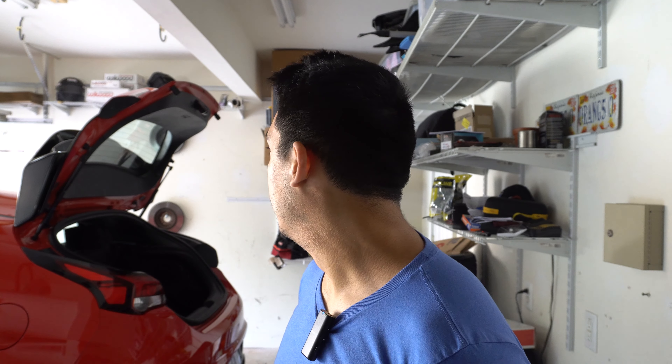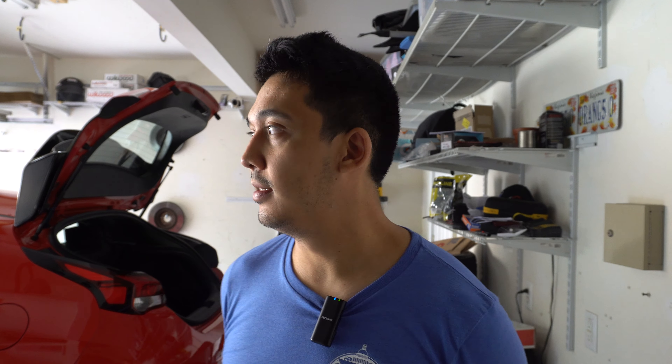The other concern is that since these are fixed static two-piece rotors, I might crack them prematurely. We'll see if they last longer than stock. The stock rotors would last me probably about half a season — roughly three or four HPDE events with aggressive pads before getting pretty big cracks. If I can get through a whole season with these, I think that's a win. Then I can use this kit as-is and upgrade later — either just the rings or move to a truly floating setup.